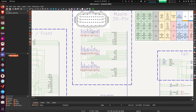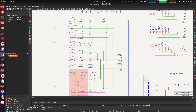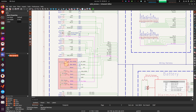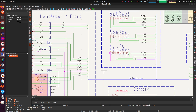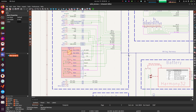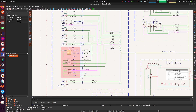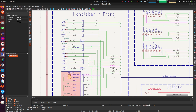They are routed to the 39-pin connector. You can follow the high beam signal — it goes to the headlight connector itself and to the input which senses it, and it goes to a switch that mechanically switches the 12 volts and activates the high beam. We use this pin to read the high beam input and send that signal on the CAN bus so you get that symbol on the display. Getting that symbol is a requirement to register it as a street-legal bike in Sweden and probably many other places.